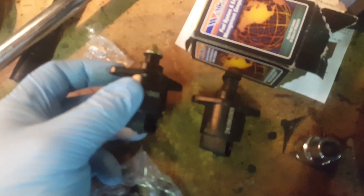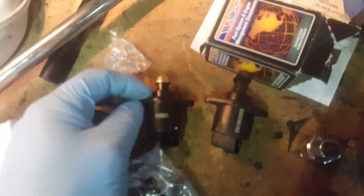Here is the brand new one. I want to make sure everything looks the same on it — see what the old one looks like versus the brand new one. It is completely different. One thing you've got to take note of: I called it an intake air control valve — that's not what it is. It's an idle air control valve, sorry about that. But you want to make sure, from what I was reading, that the lengths are completely the same. You can actually pull that out a little bit, it says, and try to get it completely even with the old one before reinstallation. So I'm going to go ahead and install it and see what happens.